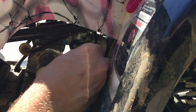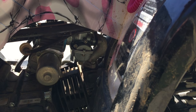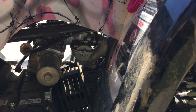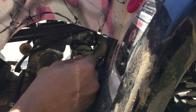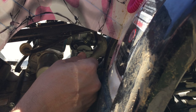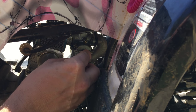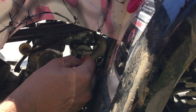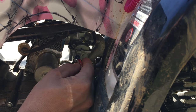If you wanted to increase the idle speed — that's a little high for my liking, everybody's got their own wheelhouse. Let's try going in a little bit more to see if we can find that peak RPM, nice and slow. We're kind of at it — it's gonna start falling off. Yes, falling off, so we're gonna bring it right back to where I had it. Hear it picking up. Check that throttle. Now these are cheap Chinese four-wheelers so the throttle response isn't the best.